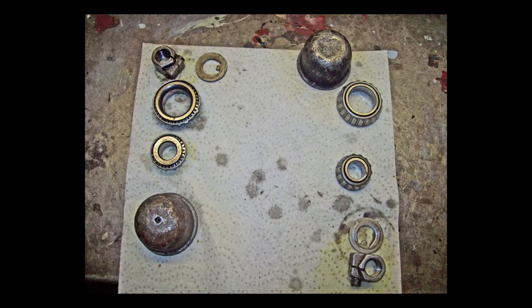Remove, clean, and inspect your wheel bearings to make sure there's no defects, no pits, no bluing from heat. Keep your left and right side separate so you'll know which drum it goes in. Use a high temperature, high quality disc brake wheel bearing grease so that your grease won't thin out and run out all over your brakes.